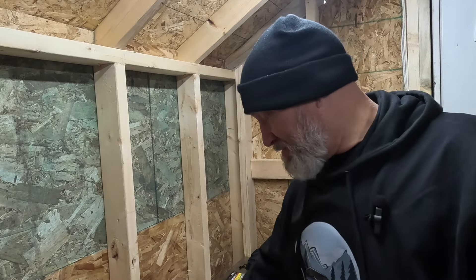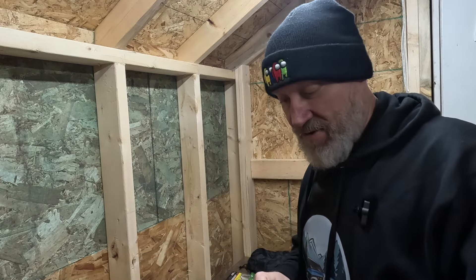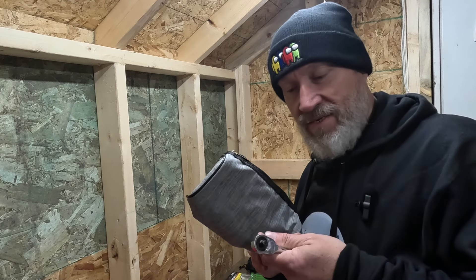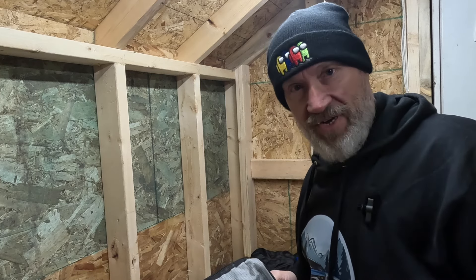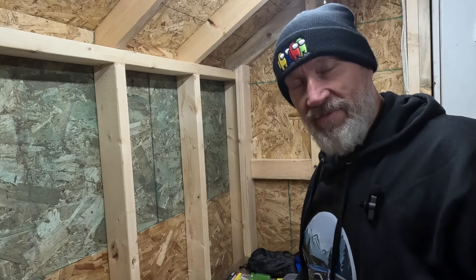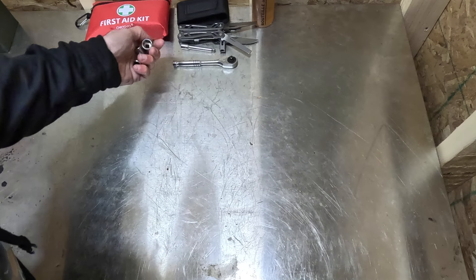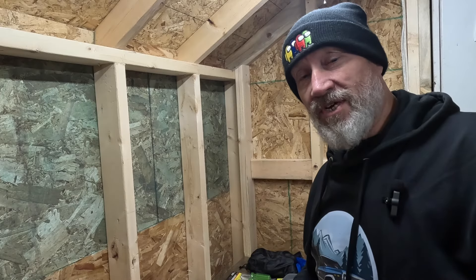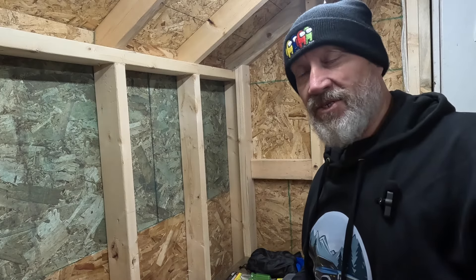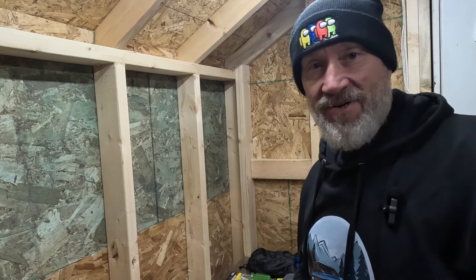Dipping into the tools: a ratchet, sockets, and an extension in a dollar store bag to keep it all together. You can buy this stuff dirt cheap at Harbor Freight in the States or Princess Auto. 6mm, 8mm, 10mm, 12mm, 14mm — those will cover almost all the fasteners on these little bikes, at least all the fasteners you'd probably be able to do a trail repair with. For larger stuff like changing your tire, 17 and 19mm sockets are useful too.